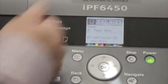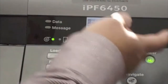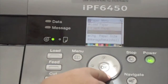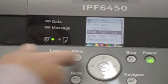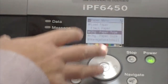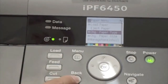If you don't initiate a function, it'll reset back to the media display. The main menu has other functions too, but a key one is changing the paper type if the media selection made when loading was incorrect. This is not a common user selection — typically you load your media, specify your media type, and just start printing. But it gives you a lot of media selection options to make specific changes if needed.